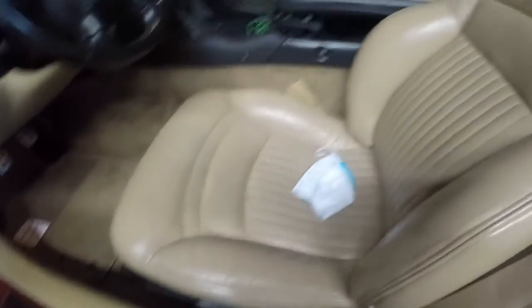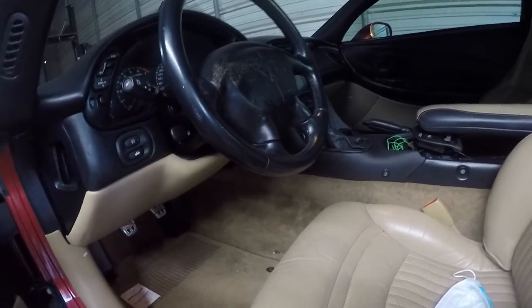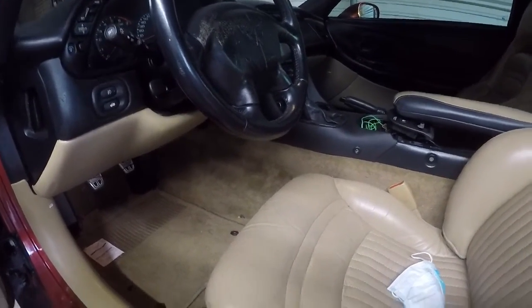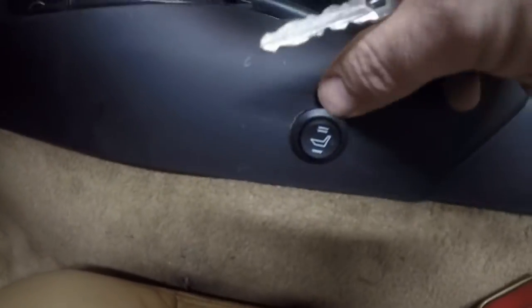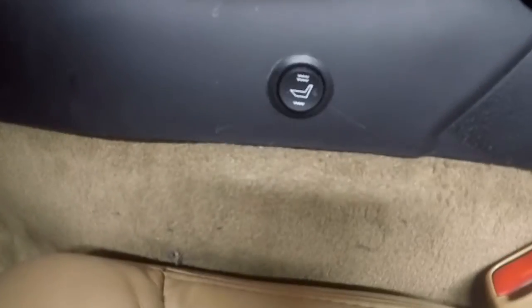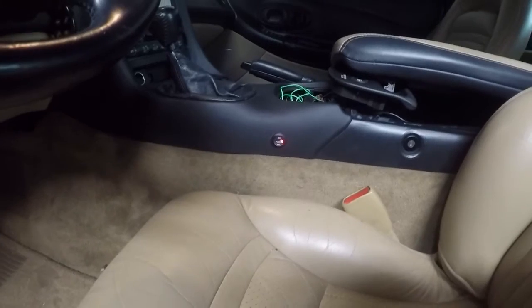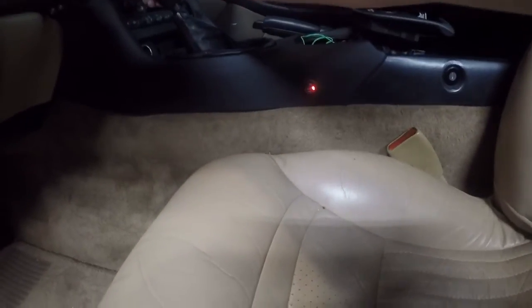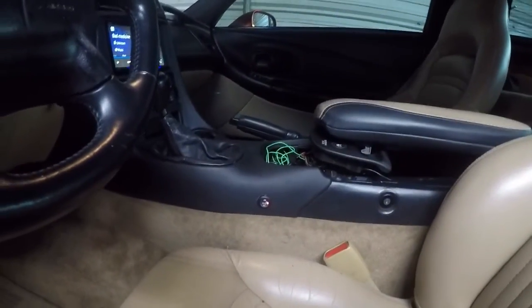Seat's back in, wiring is done — like everything else on this car, it was a royal pain. Followed the same playbook as the stereo: ran it over to the other side, grounded it, tapped into the same switched hot powering the radio. Hoping there's enough amperage on the fuse that it won't blow with both radio and seat heater on. Drilled a hole and mounted the seat heater switch. Switched on accessories — seat heater is powered up and working as it should. Thanks for watching — please remember to like, subscribe, and hit the bell icon if you enjoy these videos.